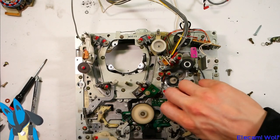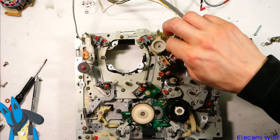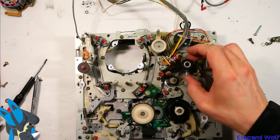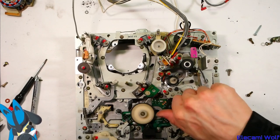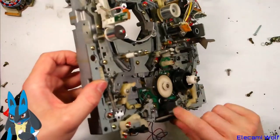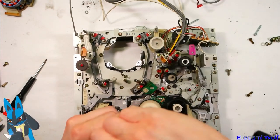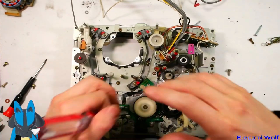It'll be the same on that one. Then there's that roller — the full-erase head, video head, then another roller, audio and control head (or linear audio and control head), then a capstan, pinch roller which pushes against it, a little hook thing to open the flap, back to the take-up reel, and an idler there which is directly pressing on the output shaft of the motor. That drives the reels for all modes — wind, fast-forward, and play.